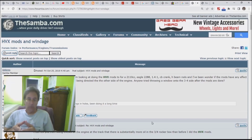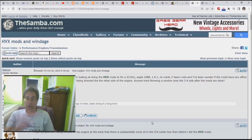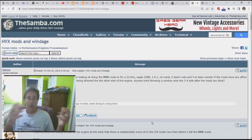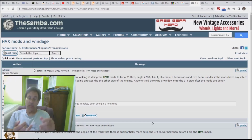What else do we learn? Well, if there's this massive pile of pulverized oil going up to the head, we know that those pulses go both directions. That also means there's a massive pile of pulverized oil going into your case. Windage. I mean, there's any number of things that you do to stop the windage. They got the windage push rod tubes. They got the windage tray. They even got dry sump systems.